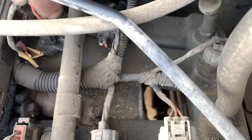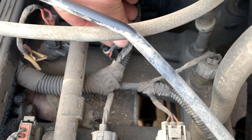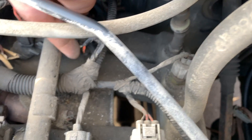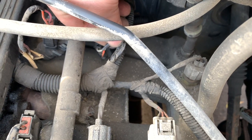I'm going to dig down here so you can see the wires. You've got your gray wire — that's your sensor wire, and you should read five volts when you crank it over by hand. The orange wire with the power on should have constant five-volt power, and the black wire is the ground. The reason you've got to turn it over by hand is that without a scope, it doesn't register the pulse — zero volts, five volts, zero volts, five volts — as I'm going to show you right here.